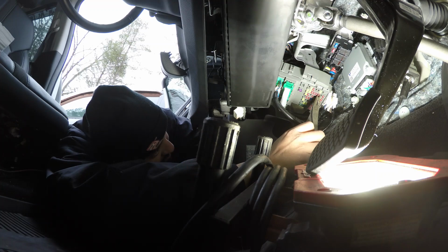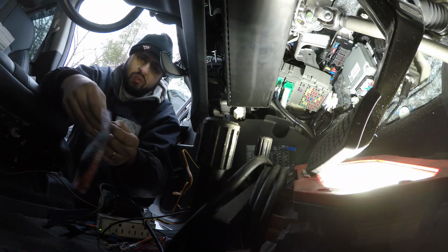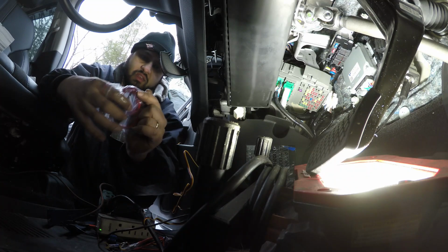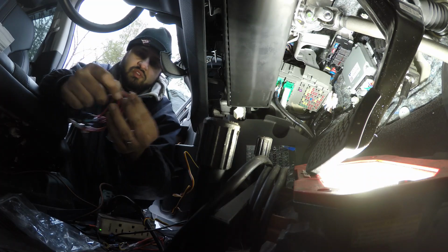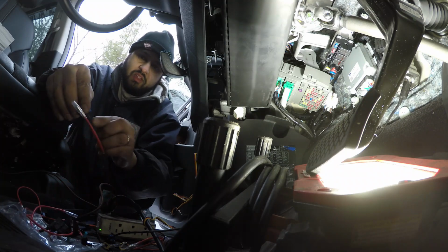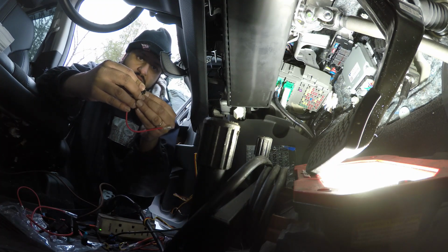Accessory was this one. So, what you're going to do is, they'll give you the hardwire kit when you order the kit. And you got to find the right one, because what they have on it is wrong, because every car fuse box is different. So, as you can see, this 10 amp fuse is a big piece here. So you want to find, which essentially it's this one right here. See, looks the same. So, you want that, and what you're going to do is plug the 10 amp into it.